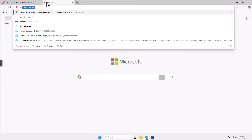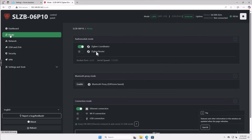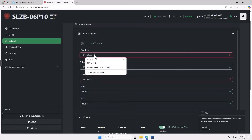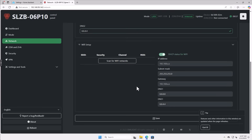I already found the IP address, and before I get started I also want to update the firmware on the device to the latest available — right off the bat, before anything is configured. This is the web interface. Let's go into mode — this will be our ZigBee coordinator. I'm going to enable the Bluetooth proxy later on. My connection mode is Ethernet, but we can change it to Wi-Fi. These devices can be configured as Ethernet, Wi-Fi, or even directly with USB like a USB dongle. Let's go to network, change it from DHCP to the exact static IP address we want, set the gateway and DNS, and click save.